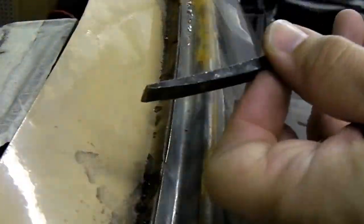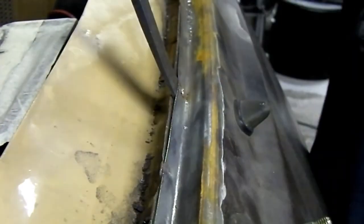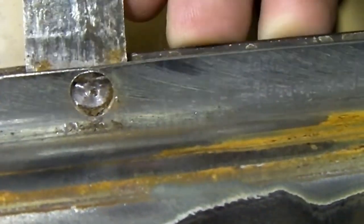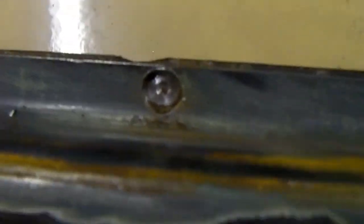I've just got this little wedge. See if I can get it in there. So that has gone and just separated the two pieces together. Can you see it moving? So that's just separated the two pieces. So I've just got to do that on every one all the way along where I can, and below, and then separate the panel. So that is how to drill out the spot weld.